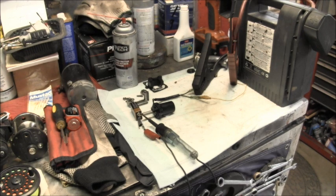Almost there. There. The light came on. So what you're seeing is how slow that thing moves, that plunger moves. But if you really want to test it, that's what you've got to do. Now, you don't have to hook up a test light. You can just get your 12 volts and set the thing a quarter of an inch away from it and hook up the two leads, and you'll be able to watch it.